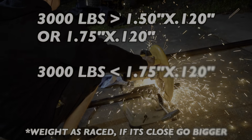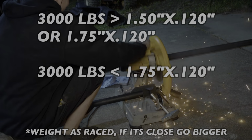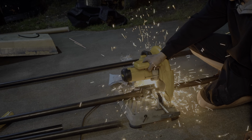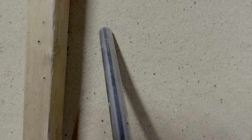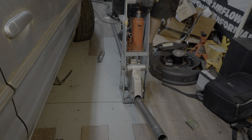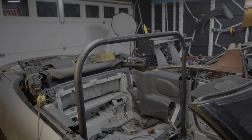Roll cage material is dependent on the weight of the car, but make sure the tube you choose or has been chosen for you is appropriate. I would suggest using DOM tubing because the cheaper ERW tube with a thick line going down it is prone to split open in an accident. It should also be said that the tube cannot crush in where it's bent. The bends must be mandrel bent.